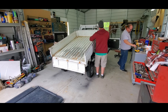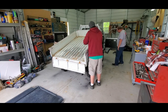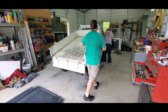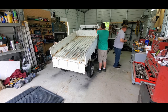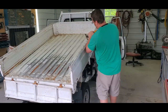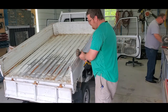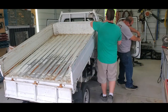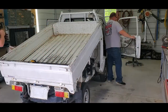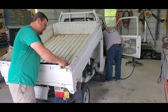I'm working on the rear bed. There were covers over the rails that had to be removed and I'm removing all the adhesive used to apply them. There was an overwhelming amount of adhesive that we had to get off in order to paint it. I'm using a wire wheel to strip all of the rubber left behind. The sides were done in 3M double-sided sticky tape with some sort of glue applied as well. The rear had some kind of rubberized heavy sealant — thick, nasty, and very difficult to remove. We need to get every bit of that off to prep the paint.